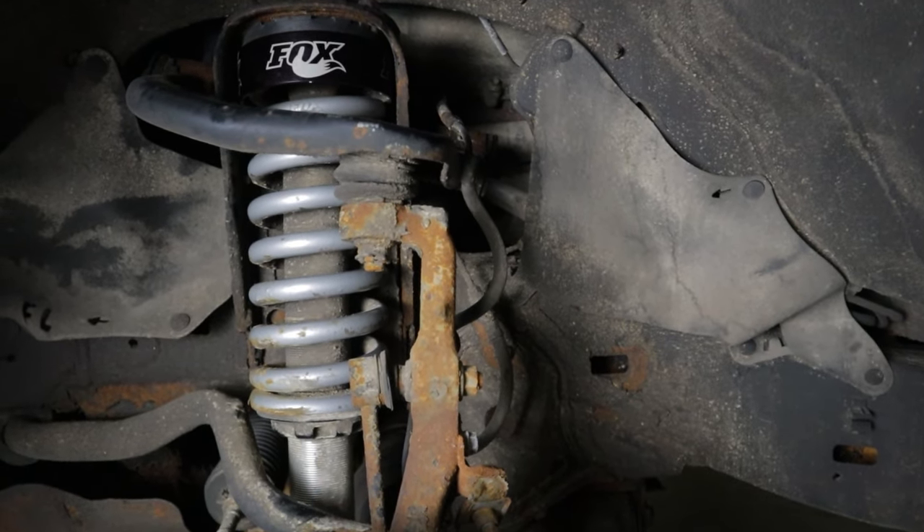You can see there is a collar here, but regular coilover wrenches won't work on this — they don't have the same pattern. That's because the slots on this collar are actually designed to be turned by hand, because when you're adjusting it there's no pressure on it from the spring. Your wrenches aren't going to fit on here. Your hand is your wrench, unfortunately. So you have to take all the pressure of the spring off that collar in order to adjust it.